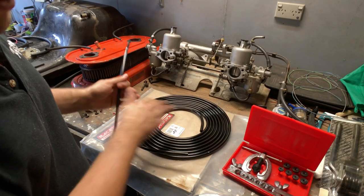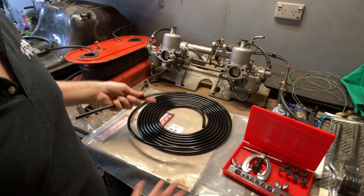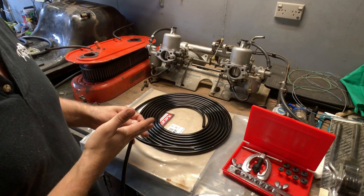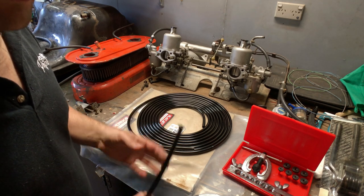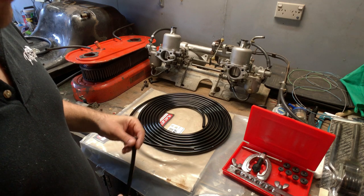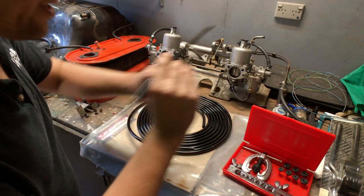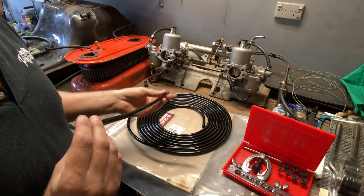This is the tubing I'm using — 3/8 aluminium tubing with a black finish, one mil wall section. It's a Raceworks product but other manufacturers make similar stuff. I've had this piece for a long time — it moved with me a number of times and there was a damaged section where something hard must have fallen on it, so I cut that bit off and gave it a test run. I've chosen not to run AN fittings; I'm going to do push-over hose barbs. I've done a double flaring procedure on the end, which does scratch off the black paint.